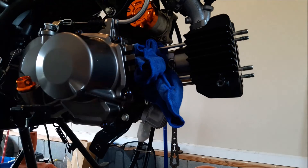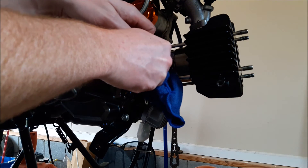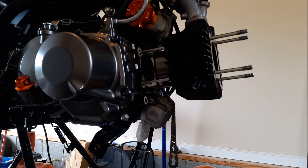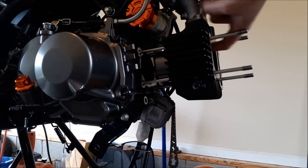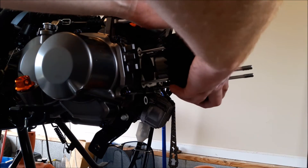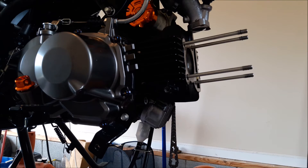You've got this other little devil here. Grab your needle nose. Make sure you've pushed your pin all the way through. I put a little more oil down in that cylinder just because I didn't put any in the top. Now you can slide your cylinder back on — line up your dowel marks.